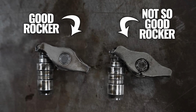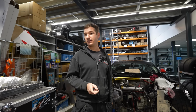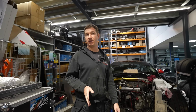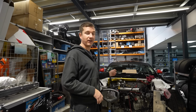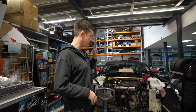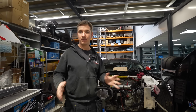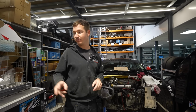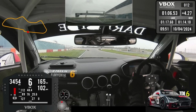So yeah, today's Tuesday. We need to be loaded up and ready to go on Thursday. Probably 6 o'clock at the latest. So, a lot of work to get that sorted, dyno tested. We need to change the flywheel in that as well, because we're not happy with that. We're thinking the harmonics might be causing us some problems here. But we did rev it to 6,000 RPM as well, miss shifting.